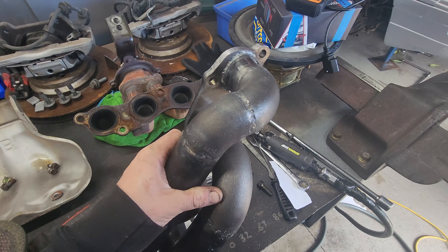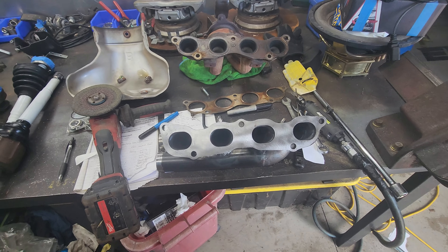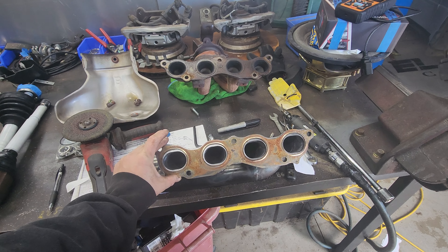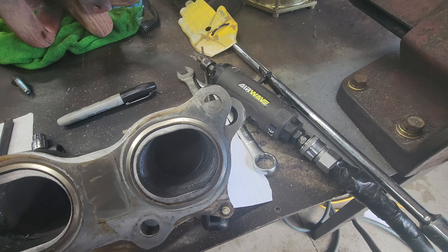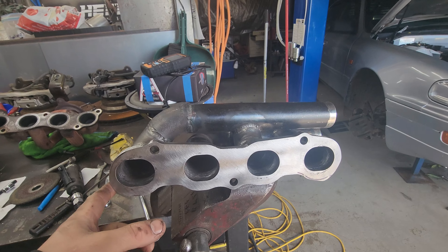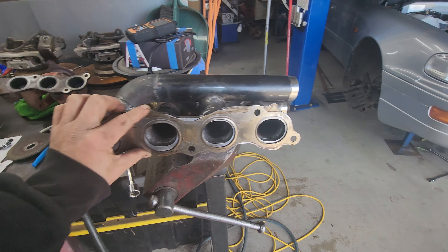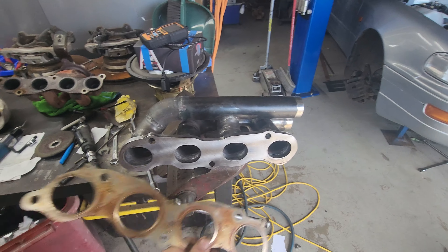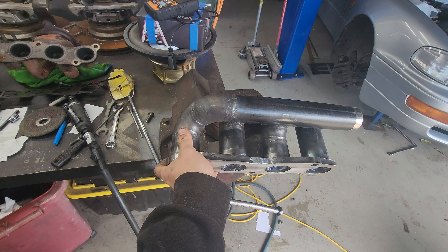I've ground down that flange and it turns out I've made a large mistake. If you look at this flange here and that one there, they might look the same - I sort of thought they were symmetrical and it fits on nicely. But this is supposed to be this way, and then it doesn't fit on nicely at all. So I have cut off the end bolt holes. I'll fix that later, and now this will fit that way, clears the hole, and it will fit that way.